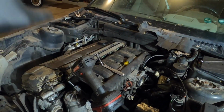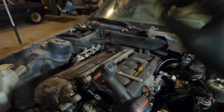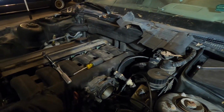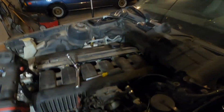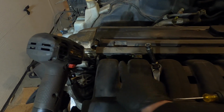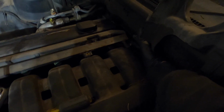So next is something that you don't necessarily have to do to pull the motor, but I do this almost always, especially because I separate the harness. So now I pull off the intake manifold. There's a bolt in each slot, basically one here, here, here, and then the hardest one is under the FPR. So you got those 7 which hold it on.